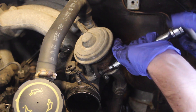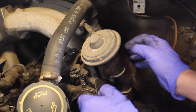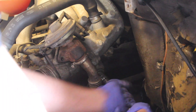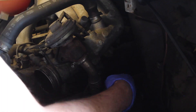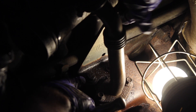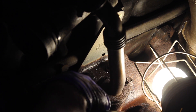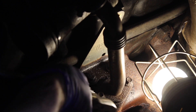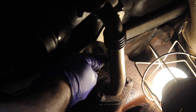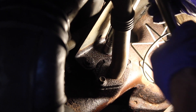I'm going to take out my EGR blanking plate for now and put it back in afterwards. There's a larger 17mm bolt in the back — taking that out. I'm trying to remove these rusty bolts which bolt this bracket into the exhaust manifold. I need to take this off so I can lift up the inlet manifold. They're very rusted in, so I've soaked them in WD-40 and I'm just being really careful so they don't shear off. Taking my time and easing them out slowly.